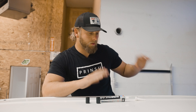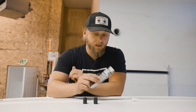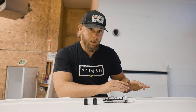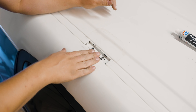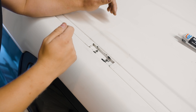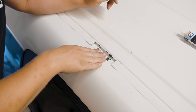The next thing we're going to talk about is prepping the roof for mounting the roof rack. The first thing we're going to want to do is get our black silicone that comes in our kit. We're going to silicone these EPDM washers and aluminum spacers down over the factory mounting spots in order to set the roof rack on top of them with the mounting feet. We're going to have three of these sections along the roof. You just take a plastic pry tool, get underneath the caps, pop them off, and it'll show the exposed factory mounting locations right here.